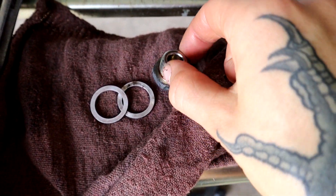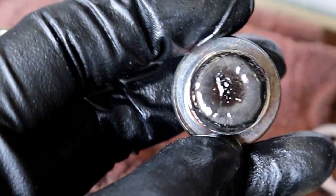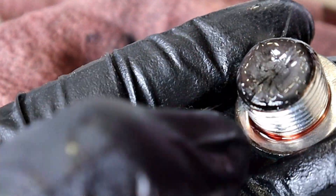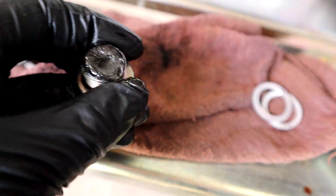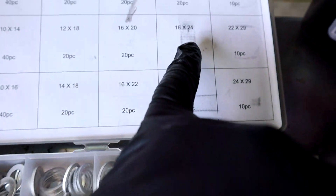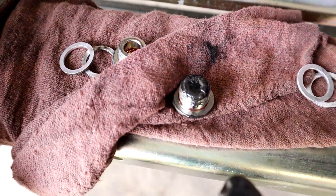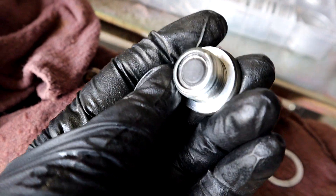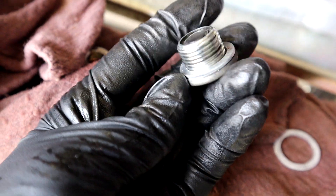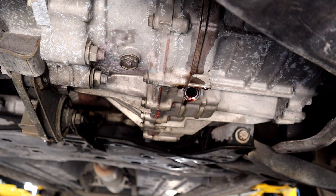Here's some fun stuff — here is the fill plug and look at the drain plug: it has a whole mountain of metallic magnetic mess on there because it is a magnetic drain plug. I'm going to clean that off really well before I put it back in. You can see my two old washers and my two new washers from my kit — they are 18 by 24 millimeters if you just want to order two of these. Here's the drain plug after it's been cleaned; you can see the magnet, and there's my new fresh washer fitting on there nice — not too tight, not too loose.